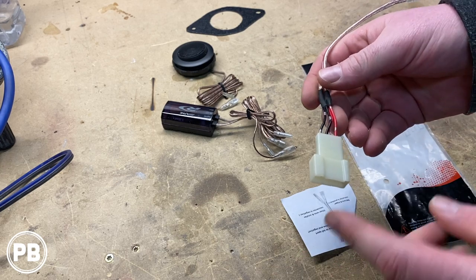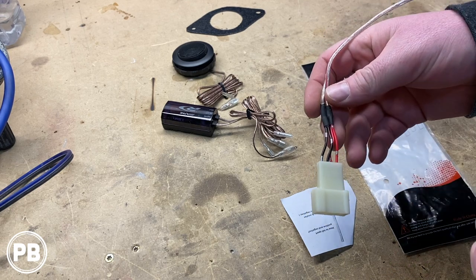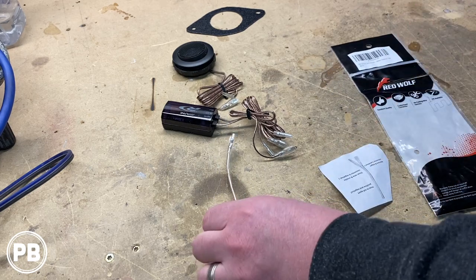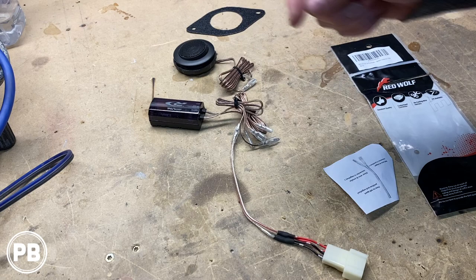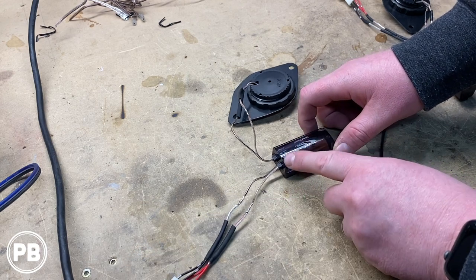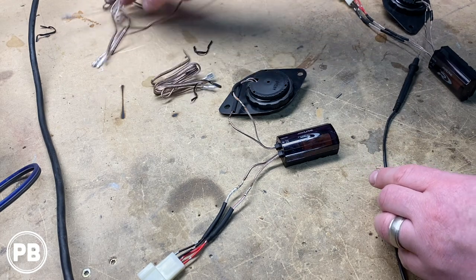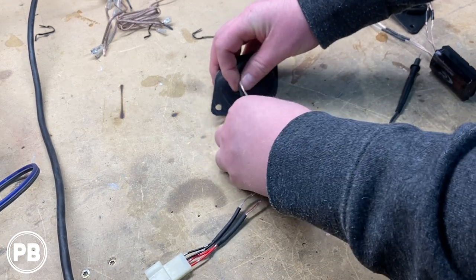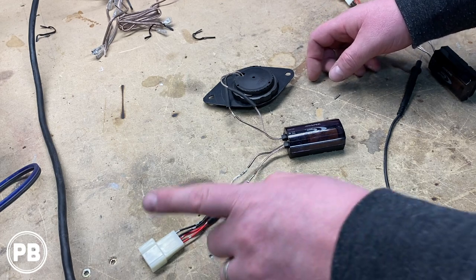Keep in mind — it's super important — the way Toyota wires the factory speakers is that the signal goes through the tweeter from the radio before it goes to the door speaker. So if you unplug your tweeter, you're going to lose your door speaker. It's super important to retain this harness to make sure everything works properly. What we're going to do is cut this end off, wire it into our crossover input, and get everything soldered. We cut the ends to shorten them up, wired those leads directly to the crossover input, then ran it through to the tweeter. Since it's such a short run, we cut most of the extra wire out and soldered the tweeter back in. After soldering, we moved the heat shrink over each connection and shrunk it down with a heat gun. Then we'll head to the car, remove the factory tweeter, and plug this one in its place.